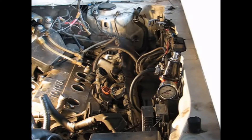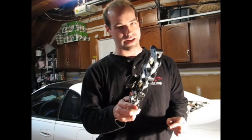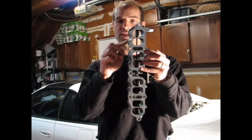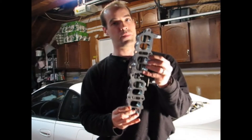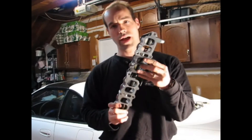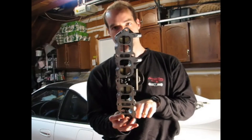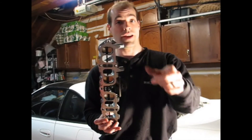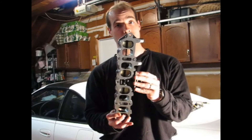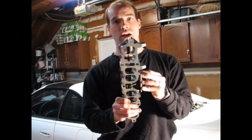See how easy that was? Next, just reach on down in there and remove the Toyota Variable Induction System plate. This is the Toyota Variable Induction System — or more accurately, the TVIS plate. It sits between the intake manifold and the head and contains four valves that are either open or closed depending on engine load and engine RPM. It's actuated by a diaphragm connected via a vacuum line to the TVIS actuator. At low engine RPM and low load, the computer closes these valves off, opening only a single port to each combustion chamber, increasing the velocity of the air going in and enhancing low end torque. Once the engine RPM comes up and the engine load rises, the computer opens these valves up, which allows more air to get into the combustion chamber to create better top end horsepower.